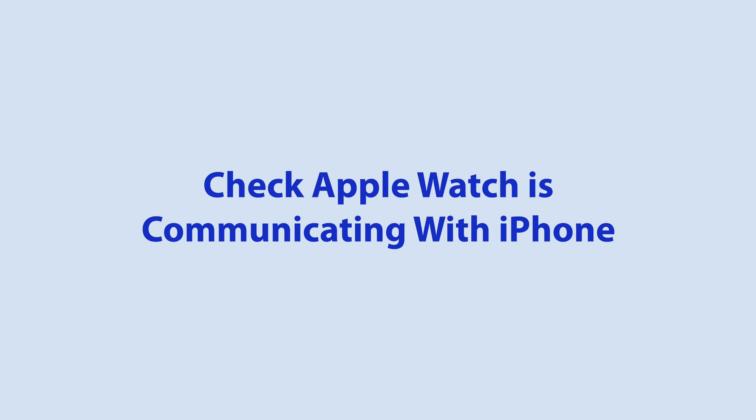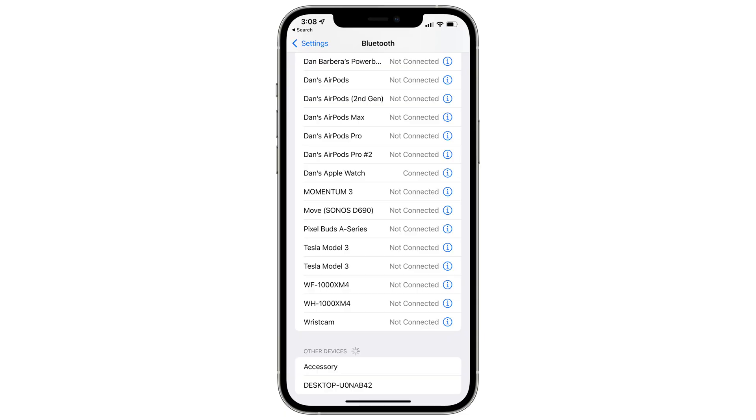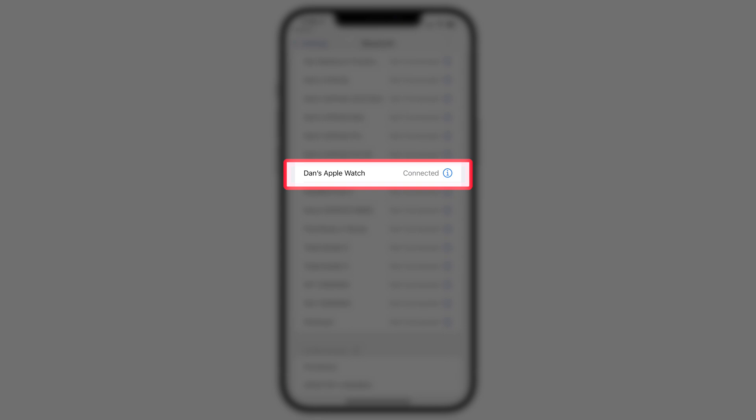For those who are having issues, there are a few things you can try to get things resolved before having to contact Apple. The first thing you can do is check and see if your watch is communicating with your iPhone. Swipe up from the bottom to bring up Control Center and check to see if there's a green icon in the top left corner. If it's a red phone with a line through it, this means you are disconnected from your iPhone via your Apple Watch, so check Bluetooth settings on your phone to see if your watch is connected via Bluetooth.